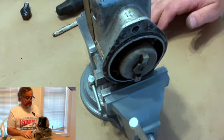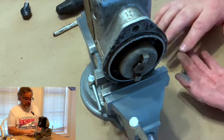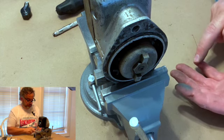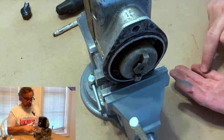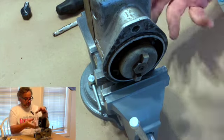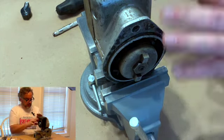Don't be intimidated by them. Like I said, there's five pieces in them. You got your armature, points, condenser, coil, and the iron core that goes through. That is all that's in it. They'll be in there different places, but they're all in there.